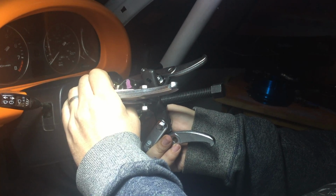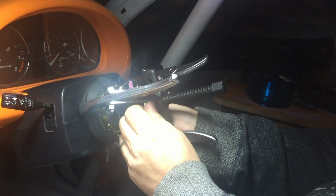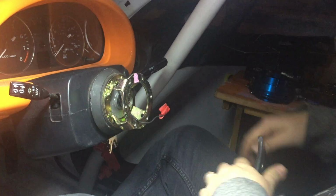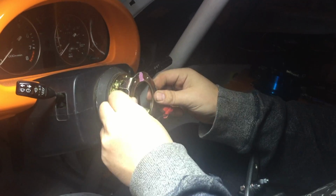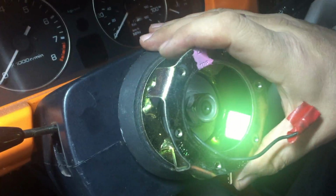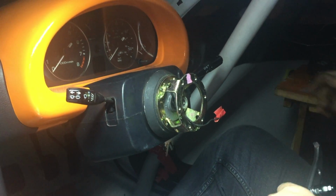You got a bit scared then, didn't you? I did. That bang was not the hub breaking. That bang was the steering hub coming loose. And that's why we leave that nut in the middle, so when it comes loose, it doesn't smack you in the face.